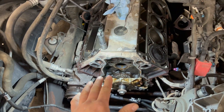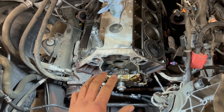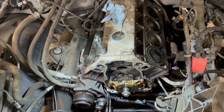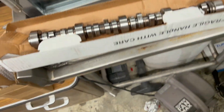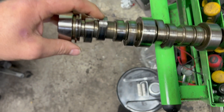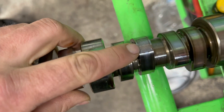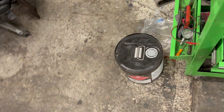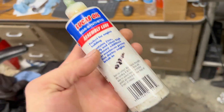We're just about to put this back together. We've got the cylinder heads with decks surfaced and we're getting ready to put a new camshaft in. We ended up finding two lobes that were bad - we talked about number seven, but I also noticed another lobe starting to come apart. What causes that? I can't tell you exactly, but I think it may have to do with bad oiling, type of oil, or not changing oil enough. The lifter comes apart and sheds.